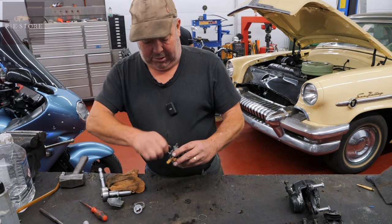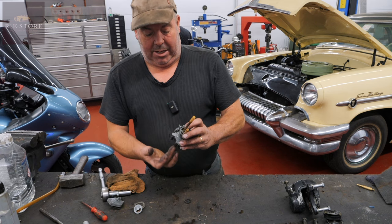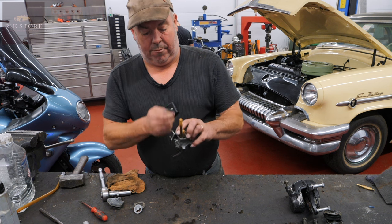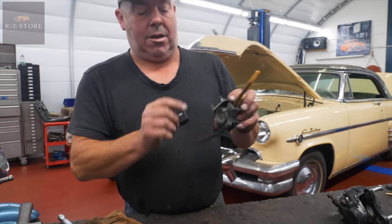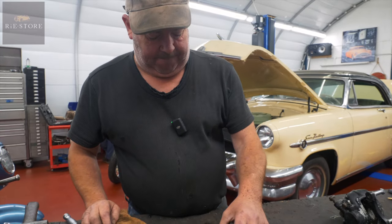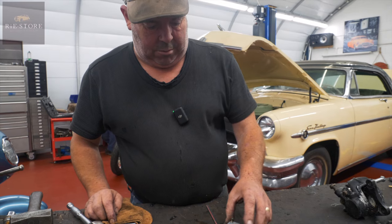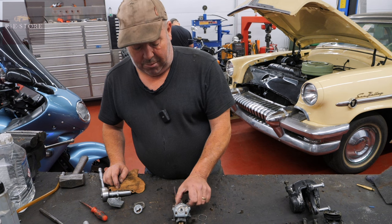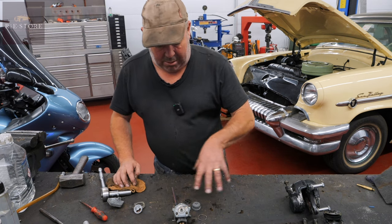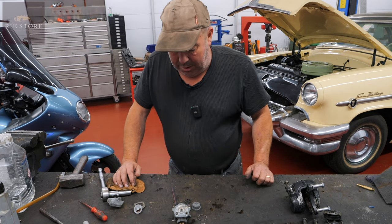Your pulse will lock it on and off. That's the sediment bowl to catch it. That's your three carburetors. Pulse goes ding ding ding in there and just lets the fuel pass out through those. What's the purpose of the sediment bowl? Is it to catch any debris in there? Catch any debris that comes through. So just a good clean out — all your new rubbers and gaskets and parts.